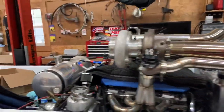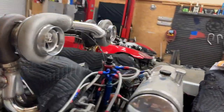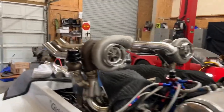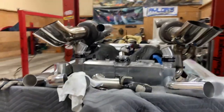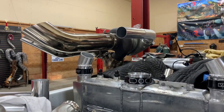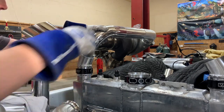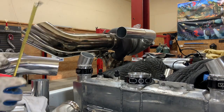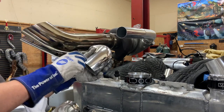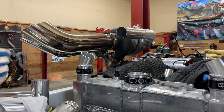Look at that tight bend out of there - that thing looks dope. From back here it doesn't look as cool. Let's come around the front - look at that thing, holy cow, it just looks amazing. So we got that there and the next step is going to be to measure - looking down this piece, we've got two and a quarter, so we'll cut a little straight piece two and a quarter. If this was a 90 it would have been better - one leg instead of two welds - but that's all we've got to work with right now.